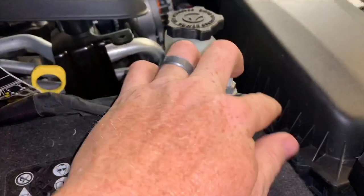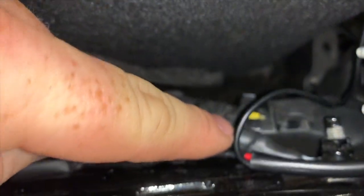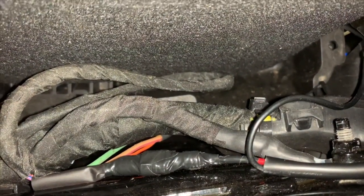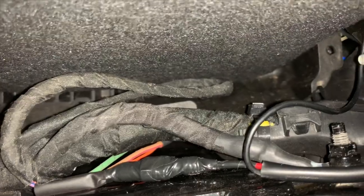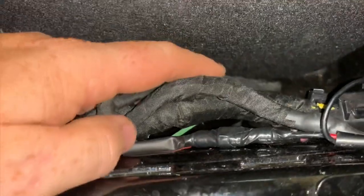The ground literally just goes right on the negative post. There's a little loop with the wiring harness that runs right down into the battery tray. There's the harness all wrapped up nice and tight. Make sure you're wrapping or heat-shrinking your connections to keep water and dust out. The extra wires are just tucked down there for now — they'll be hooked up to something else shortly, but they're still shrink-wrapped. The top part is wired up and ready to go; now it's just tidying up the rest of the harness underneath.